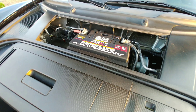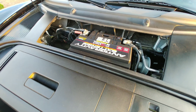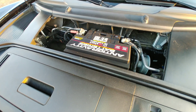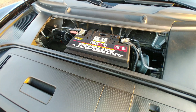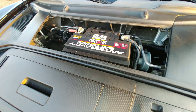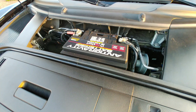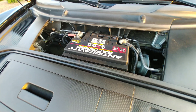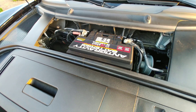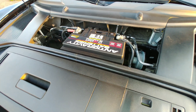A couple other things to note: I did a search and a replacement lead acid battery like an Optima would be half the cost. The Optima has more amp hours — I think around 70 amp hours versus this one's 40 amp hours. I haven't noticed any difference in operating the car. Everything seems to work fine. I think maybe if I took a super long trip that difference would come into play, but so far so good.